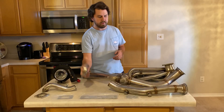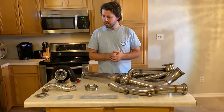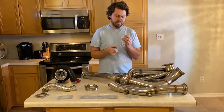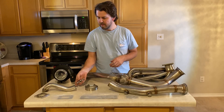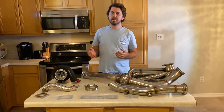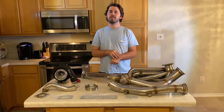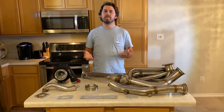It comes with a three-inch V-band for the downpipe, and hardware for the turbo and wastegate. Don't use this hardware — it's grade 4.8 and comes with lock washers. You're going to want to purchase either Nord-Lock fasteners or ideally an OEM-style copper bolt, because I've never had one of those back out. The closer I can get to OEM, the happier I'll be.